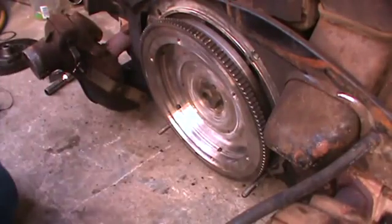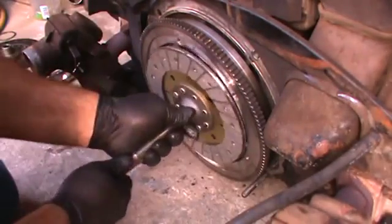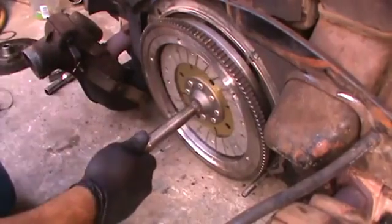Here's our disc — you can see it was time. You can see the wear grooves in the new disc there, those lines. You can see how they're very faint on this one — they're almost gone. Unlike the other disc, there's no cracks. This is an original disc. This one's heading the same way — there's barely any lines on this side and it would crack in the rivets soon. Not only did we correct the oil leak, but I think we caught this in a good time. We're not wasting any money here.